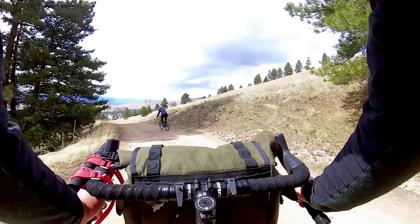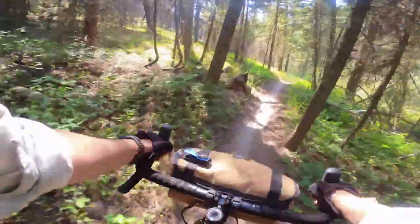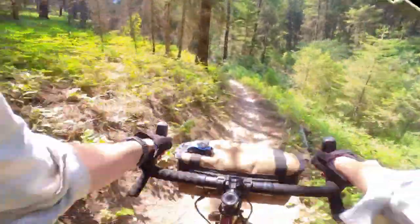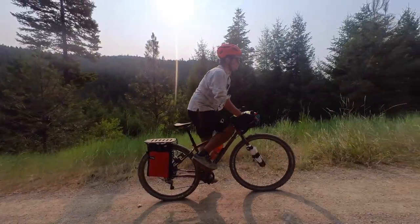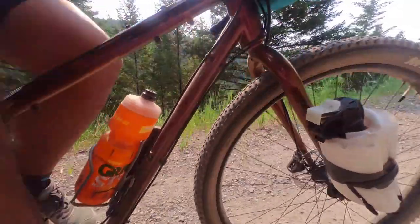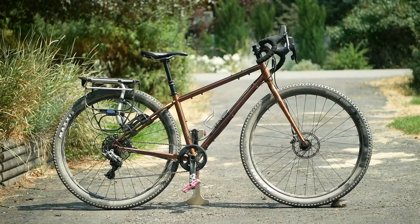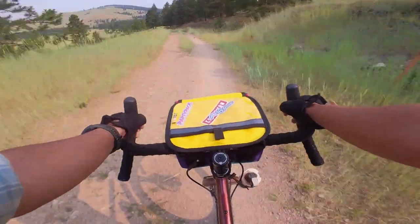With my time on the ULTD, I took it on the gravel loops here in the area as well as some single track. Unfortunately I didn't get an opportunity to fully load it for an overnighter — it's been too smoky with wildfires, and that's just 2021. Overall, the bike feels very stable. It's got a longish chainstay at 445mm, and a 69.5 degree head tube angle paired with a 55 millimeter offset. With these tires, the resultant trail is about 79 — definitely a lot higher than your typical endurance road bike, creeping into mountain bike territory.